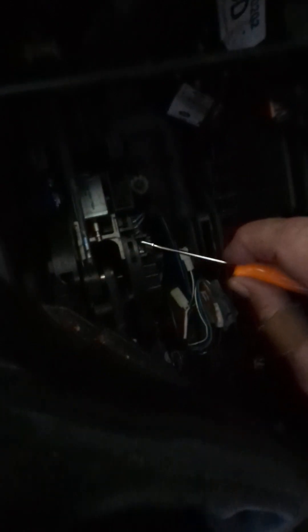Now this is what you're looking at. Here's the selector switch, but this is the only part that matters right here — this little metal tab. When you go forward and put the car into park, what happens is it pushes up on that tab and indicates that to the car.